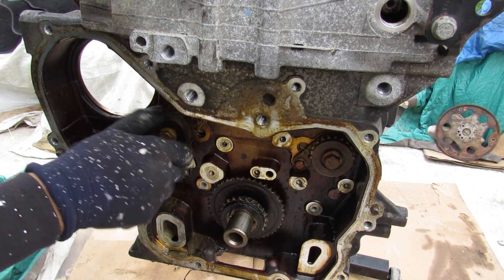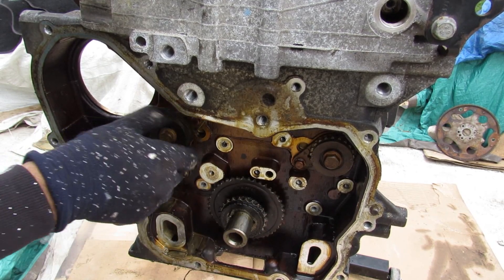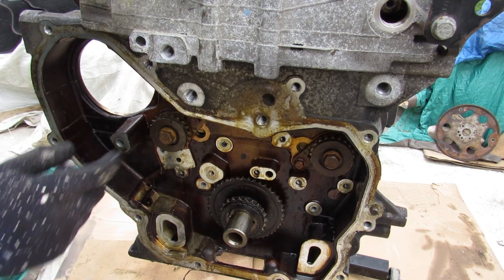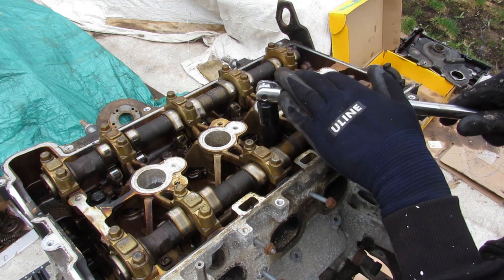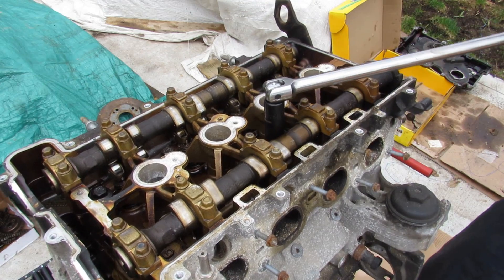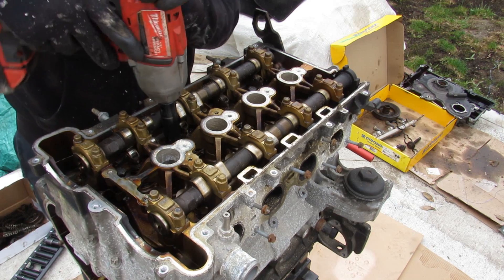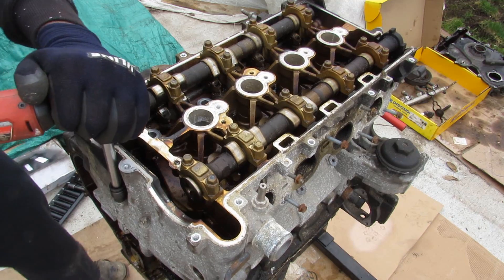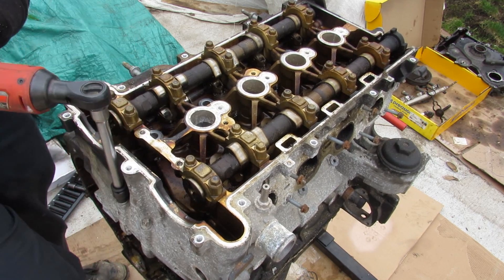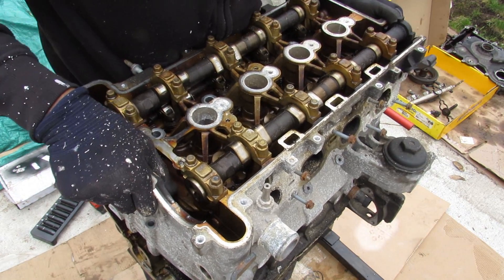These two gears here are more than just idlers — they're actually balance shafts integrated into the engine block. That's right, this engine has balance shafts in the block, not down in the pan. I'm going to go ahead and remove these fasteners and then remove all the head bolts so we can get the head off. These are 15mm bolts, and like the BMW this one's got a couple of E-Torx bolts too.